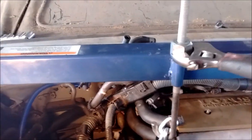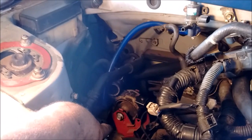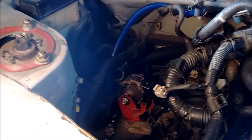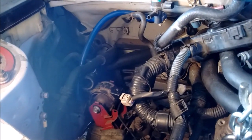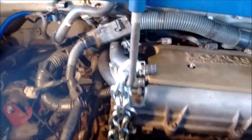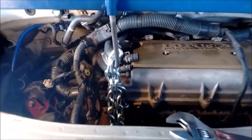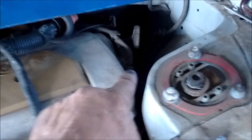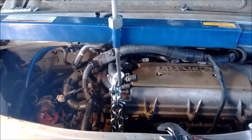What I've done is turn this to add tension — enough tension so that I've taken the weight off the transmission mount completely. Now I can loosen the transmission mount and the engine and transmission will be supported by this engine support. The two front and rear mounts have been removed already, so the only things supporting the engine at this point are the transmission mount, the engine mount on this side, and this engine support bar will be taking up the load when we remove this mount.